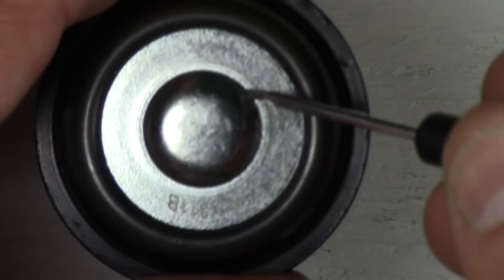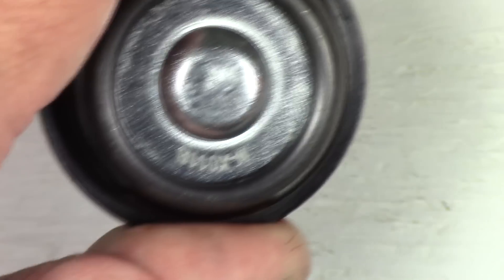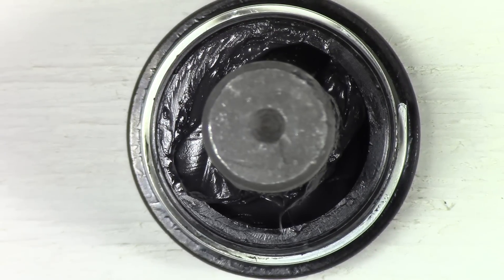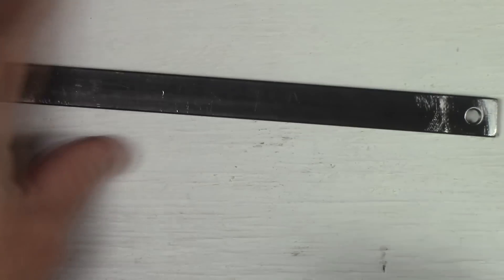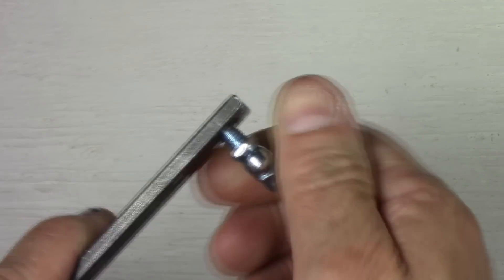In order to do that, I'm going to tap this bottom piece here — which has got lots of metal — and thread it and then put the Zerk fitting right on the end like so. I've got a drill press to do all this, which makes my life much simpler than doing it by hand. But it's totally doable by hand. I've got a piece of flat steel here that I've already drilled out using hand tools, tapped it, and put threads into it — and it works perfectly.